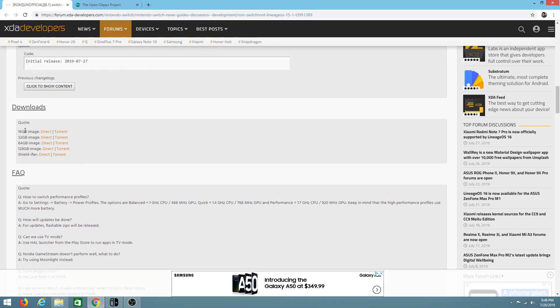Going into the downloads area, we have four different size image files. I don't know if you can use a higher size SD card, but you can use a lower size image file if you have a higher size card. So if you have a 128 gig, you can use a 32 gig and so on. If you have a 250 or 400 gig SD card, you might want to use the 64 or 128 gig images because they're formatted in exFAT. Both exFAT and FAT32 will work just fine.